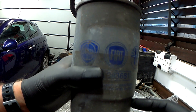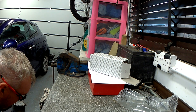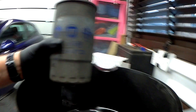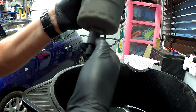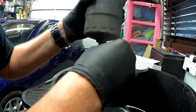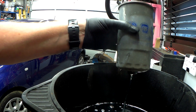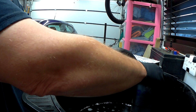You've got to be careful because this filter is full of fuel, so get a container to put it in. I've got my old container here. We need to undo the filter — just twist it. It's not very tight at all, just undo that and there you go — all the diesel comes out, which is why you need a bucket. Just leave that draining in there.